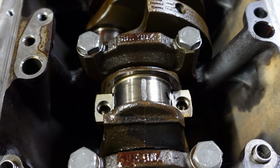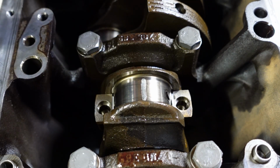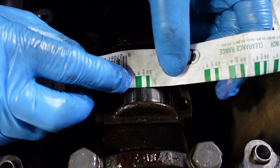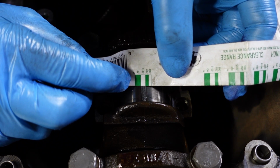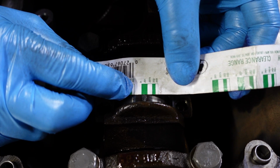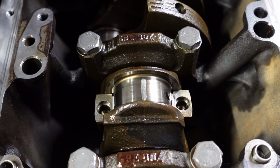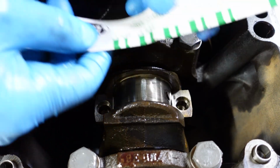All right, so there's our plastic gauge mark right there. That line, we measure that up. Let's see what we get. It's hard to tell because you guys are in the way. That's looking like 1.5 thousandths to me. Yeah, it's definitely too small to be 1 thousandth. That's dead on. Wow. Just like the main bearings, they're exactly at 1.5 thousandths clearance. That's crazy.